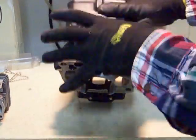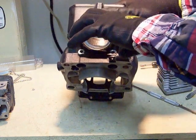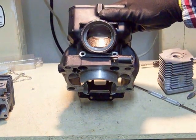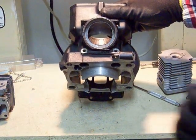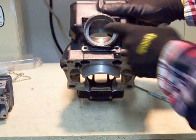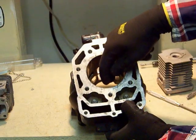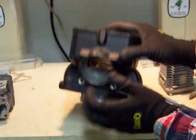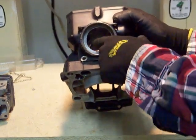If you're into two-strokes you'll notice a lot of tuned pipes — all two-strokes will have that pipe that expands out and contracts back down. Those pipes are tuned in a specific way because they actually play a functioning role: they reflect or refract an exhaust pressure wave back into here. That reflected exhaust pressure wave keeps the new charge that's coming in from just escaping back out. That pressure wave typically takes 0.003 seconds to return.